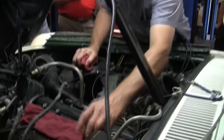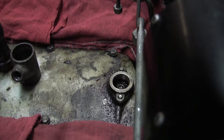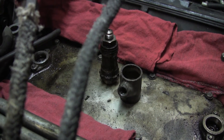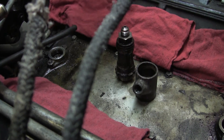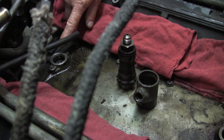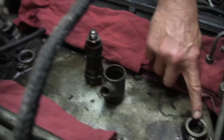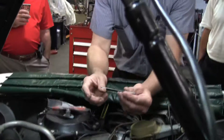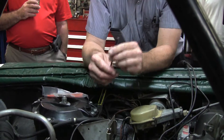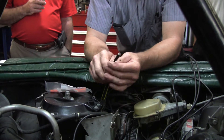What I did was pull out the rear pump to check the push rod. Now if you look at this one, notice how it's far down there — the push rods should stick up here. There's an actual measurement: when the push rod is all the way down to the bottom of its stroke, on the low side of the cam — there are two extra lobes on this cam for this — you should have just over half an inch. The exact measurement is 0.522 to 0.525 inches. This one is down. It's stuck.